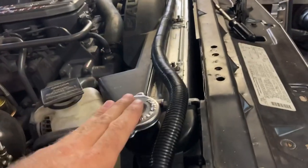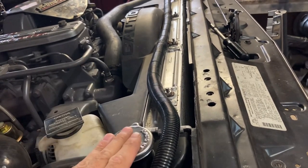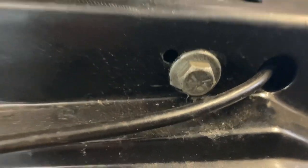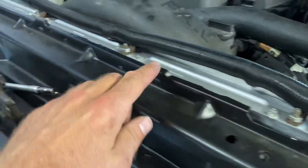You need it down as far as it will go — I didn't weld any spacers or pipes or anything in there because this just clears the hood. This radiator has to be all the way down so that just that little bit of rubber on the factory spacer is sticking up. Drop that in and it fits right in between the intercooler. I slotted my holes so I can move it up and down, but you really are going to need it pretty much all the way down. You can see I've ground my washers flat — if your radiator mounting bolts are right down on there, that means you're where you need to be. This is just about flush. If this is sticking up at all you're going to have trouble closing the hood. Once you do that, everything just fits right in there — hood closes, no problems.